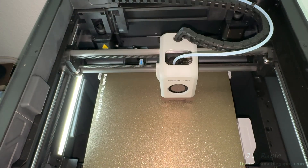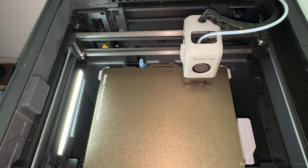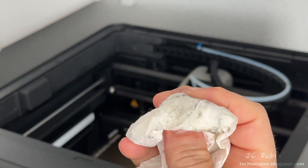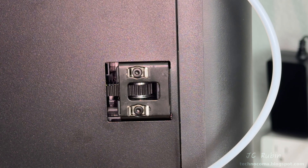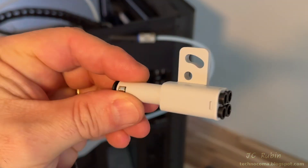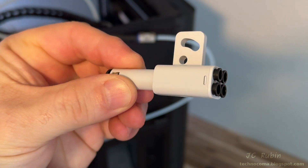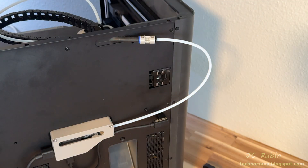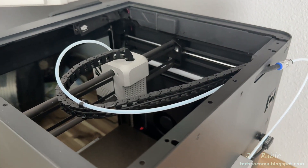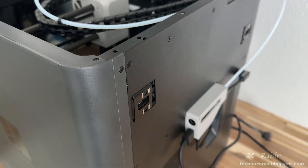What I can fix is documenting my regular maintenance. So today I'm going to capture my general maintenance, address the issue that causes belt squeak, and make some final modifications so I can run TPU and AMS at the same time. I've turned the machine around to the rear so I have access to the pulley tensioners, removed the glass cover and AMS connections, and unplugged from mains power.